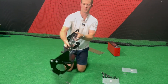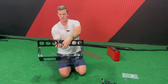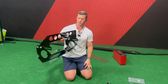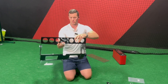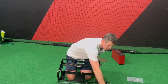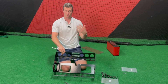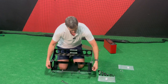You can see from the side the U-bolts coming out the back. You come up on the ladder or scissor lift and slide these right up the pipe. We'll have pictures and information on exactly where on the pipe, but you want to leave about one to two inches of space at the bottom — you can put a bolt across for extra protection. Once you slide it up, tighten on the top with your socket wrench. You want those as tight as possible since that's what's holding up the brackets, sensor, and everything.